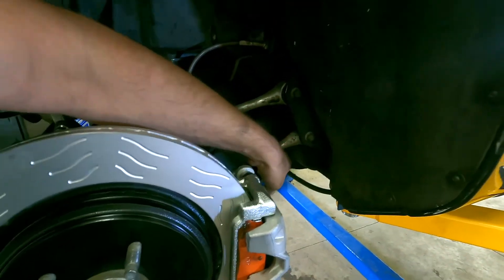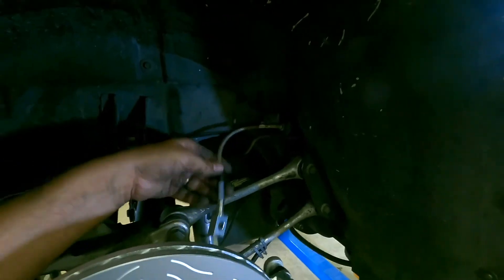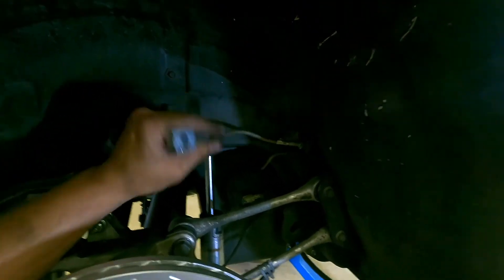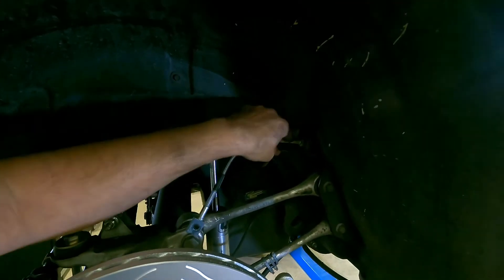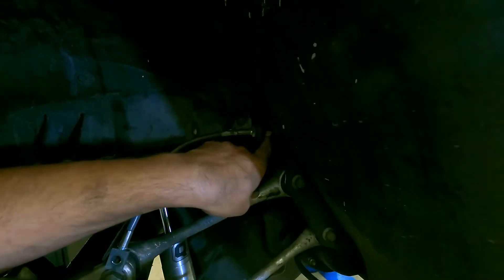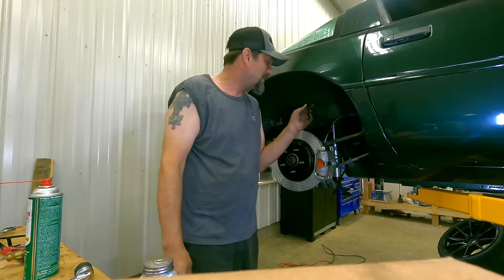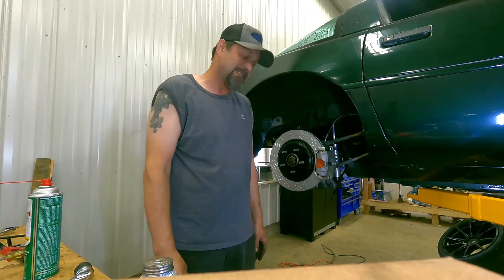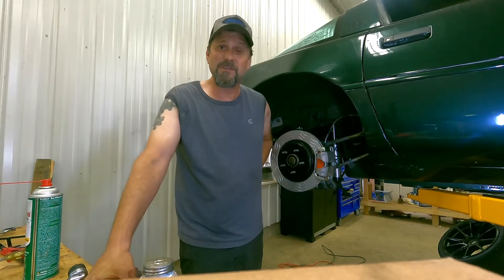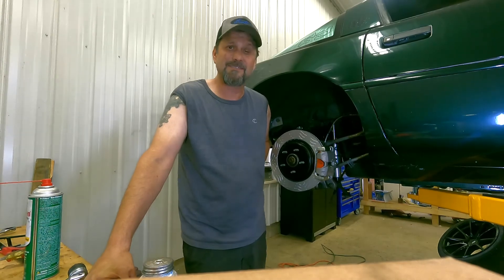I've got to disconnect all the parking brake line — I'll do that underneath so I can get rid of all of that. I need at least an 18-inch brake hose. It's on order, so it'll be here tomorrow. It's pretty simple: just connect it here and here, take it out, put a new one in, hook it up down there. After I change the brake hose, I'll bleed the brakes and we should be good to go. Thanks for watching, hope this helps somewhat. Stay safe on the track. God bless.